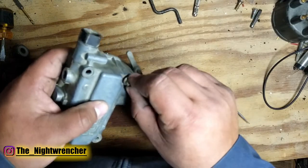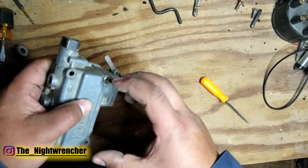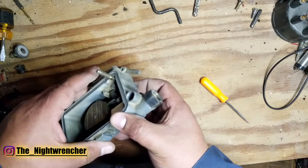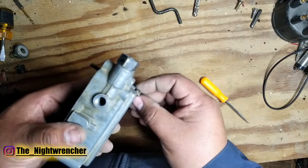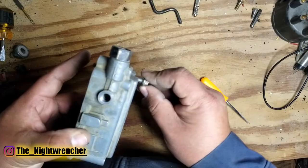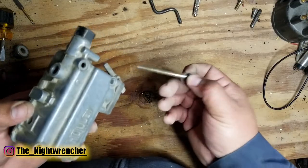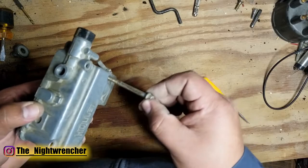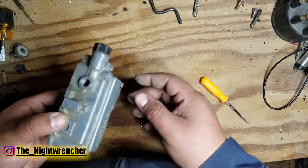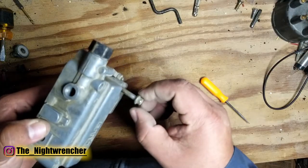People often try to cure these leaks by over-tightening the bolts. While it might temporarily cure the leak with more pressure on the seal, you can actually pull the threads out of the main body and ruin it — then you're looking at drilling it out and installing a helicoil. I've never pulled the threads on a main body; when I notice I'm putting too much pressure I back off and check everything, because it really doesn't take much pressure to get a nice clean seal. Once I notice things getting wet or moist, I tear it apart and repair any questionable gasket surfaces.